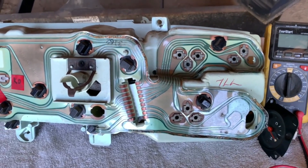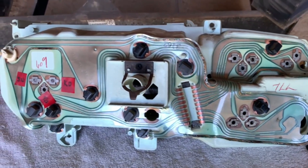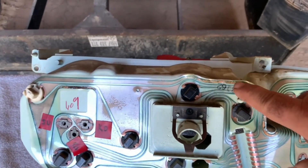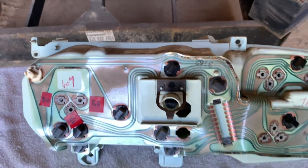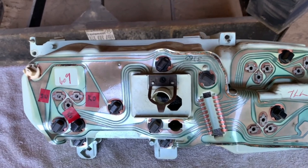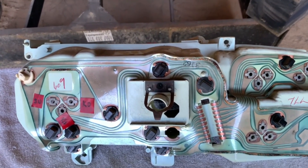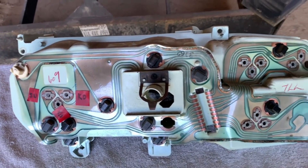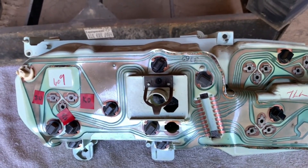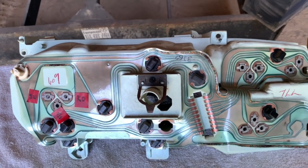After 40 or 50 years, these OEM circuit boards do wear and get buggy. They collect moisture and dust, they will short circuit, they will burn. If you have the dash out and you've already got some issues with either the lighting, turn signals, or your other gauges, now is the time to go ahead and replace that circuit board. Fortunately, they're still available from aftermarket suppliers and they're not hard to locate.